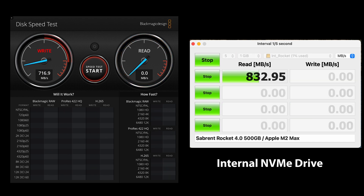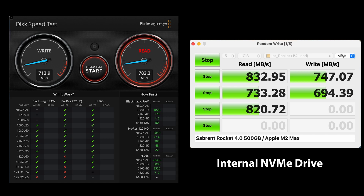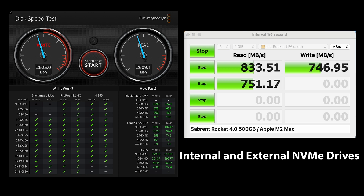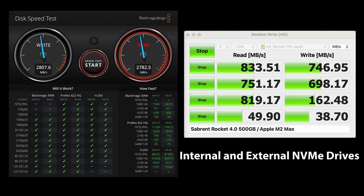Next, I took a quick benchmark of the NVMe drive that I put into the docking station itself. Per the documentation, this NVMe adapter is a PCIe x1 device, so it's limited to around 800 megabytes per second — and as you can see, it performed as advertised. To see how multiple devices play a role in performance, I ran both the external NVMe enclosure and the internal NVMe drive in the docking station at the same time. As you can see from the benchmarking, both drives have not slowed up at all, and they're benchmarking the same when run together as they did when run separately.